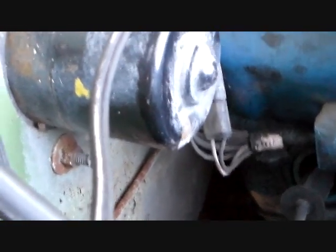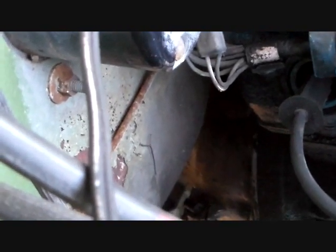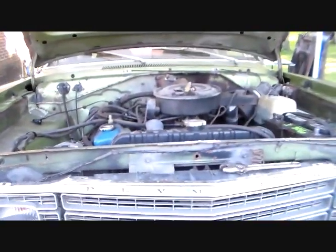And keep in mind that your dipstick is retained by one of those bell housing bolts, so before you put everything together, be sure you put the dipstick in. So then from there on, once I get those all in, I'm going to go ahead and put the transmission mount in, bolt it up, and this thing will be officially mounted in here. See you then.